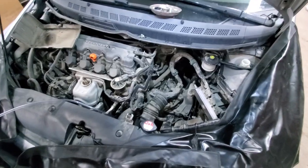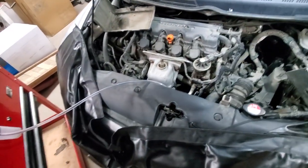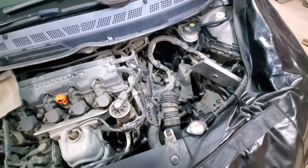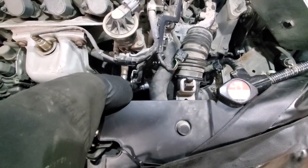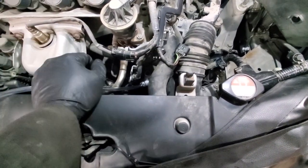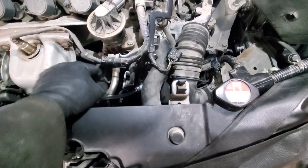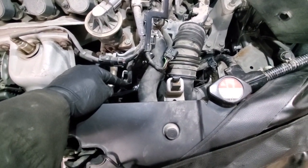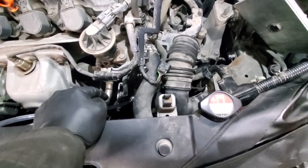Now we'll go back under the hood. The clutch master cylinder is installed and now we'll use a vacuum pump — I have an electric one, but you can use the manual one; I'll leave a link in the description. The manual one will take a while, so my suggestion is to get some help: one person pumps the clutch and holds it down, you release the bleed screw on the slave cylinder to let fluid and air out, close it, release the pedal, and repeat until all air is out. With the vacuum pump, we get that bleeder screw a little loose — not too much, because if it's too loose it will suck too much air on the thread. Alternatively you can use Teflon tape to seal it better.